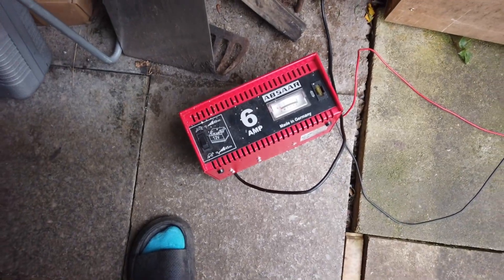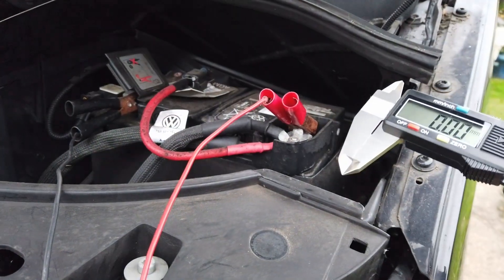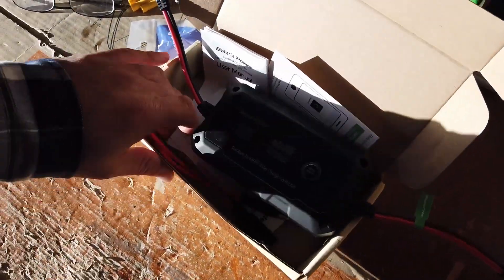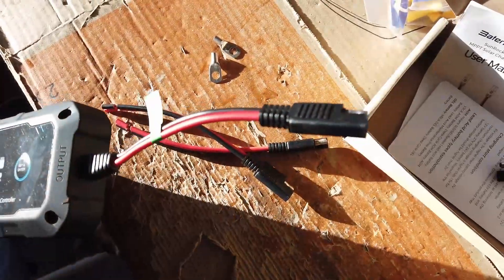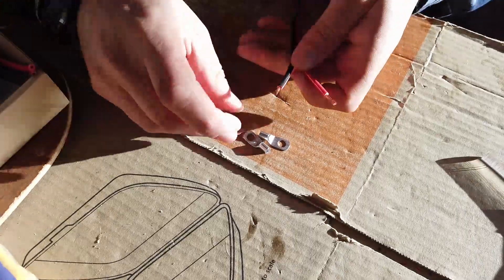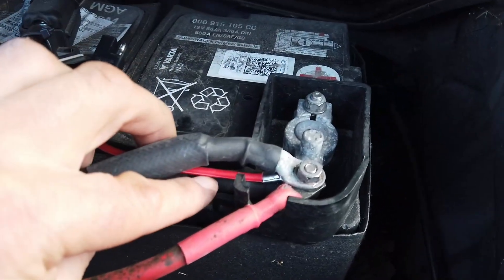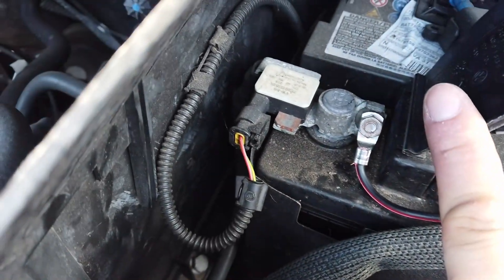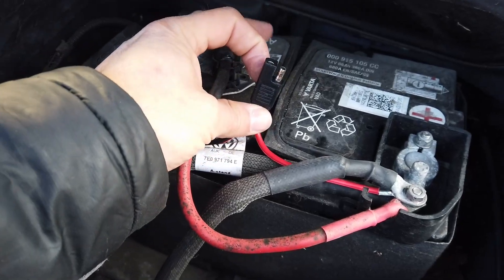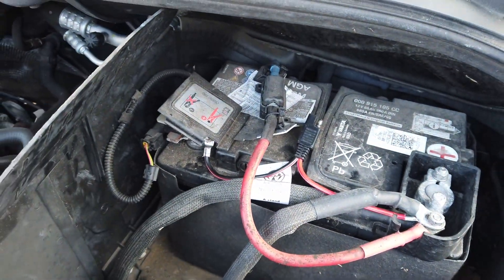For the short term I've put one of these battery chargers on it, which I've got to be honest I absolutely hate — long cable going all the way up here to the battery. Everything comes fitted with these on both ends of the controller itself. I'm going to go ahead and get some of these terminal crimps on here. It's connected to the positive terminal and also connected to the negative terminal of the battery. So we've got our charge connector now sitting nicely on top of the battery where it's not going to touch anything and shouldn't cause any problems.